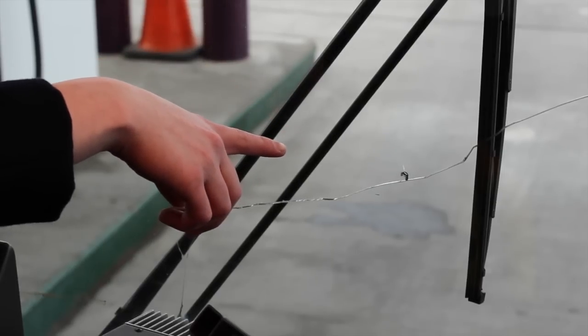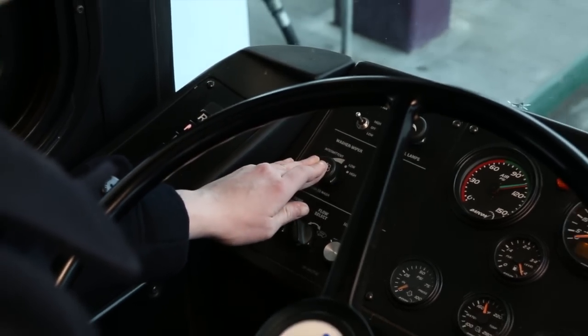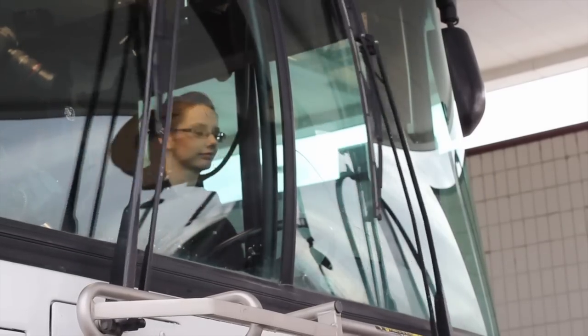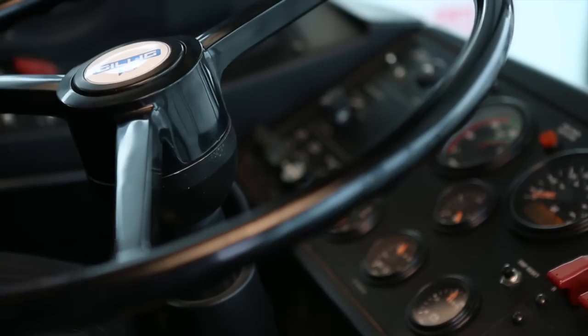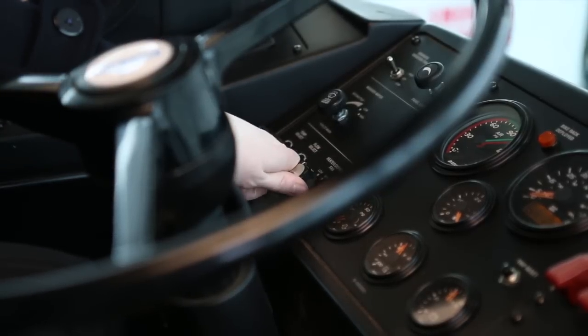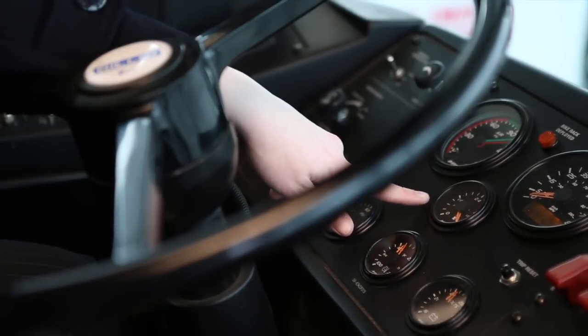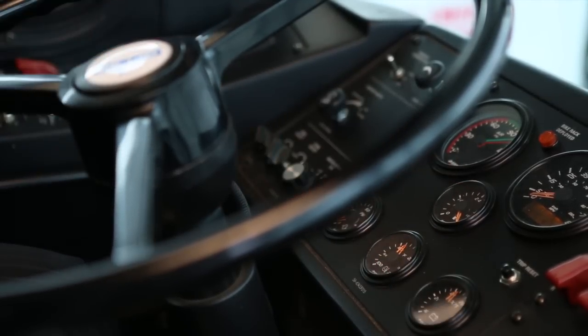Check your windshield to be sure it is clean with no illegal stickers, no obstructions, or damage to the glass. Mirrors should be clean, properly adjusted, with no cracks or damage that impair the vision. Be sure that your wipers and washers operate smoothly, are not damaged, and are secure. Demonstrate that the horn is operational. Check to be sure that the heater and defroster are working. Identify each gauge and be sure they are within normal ranges. Check your left and right turn signals, high beams, and four-way flashers.